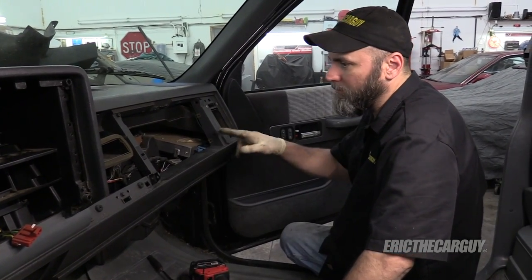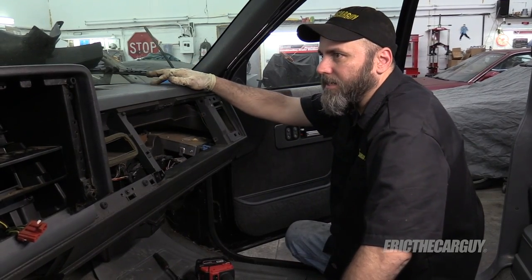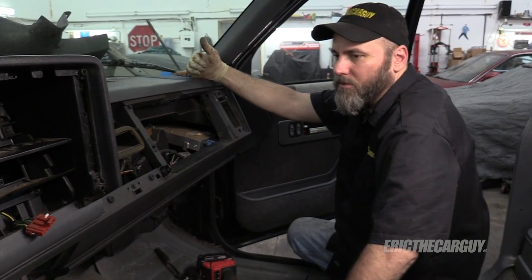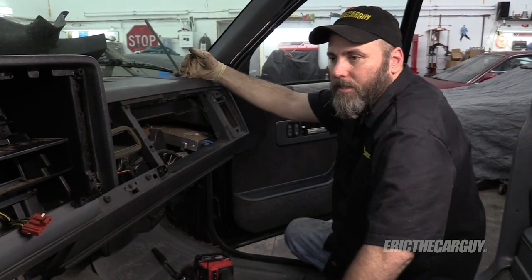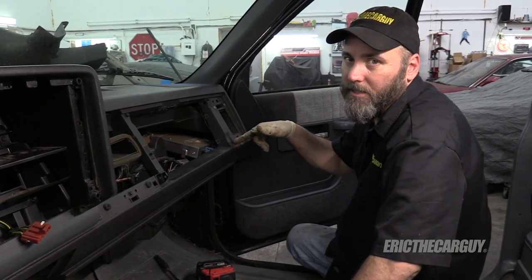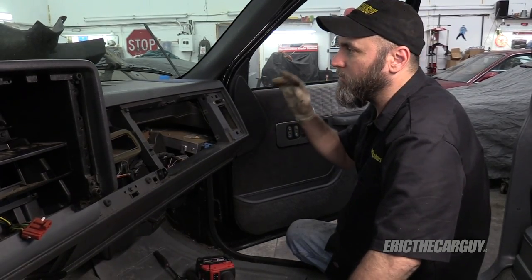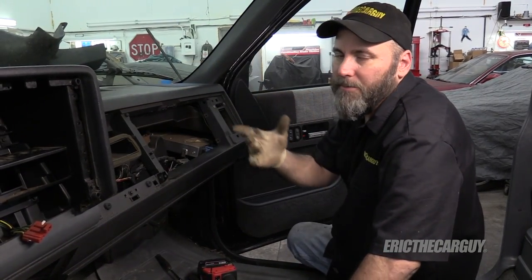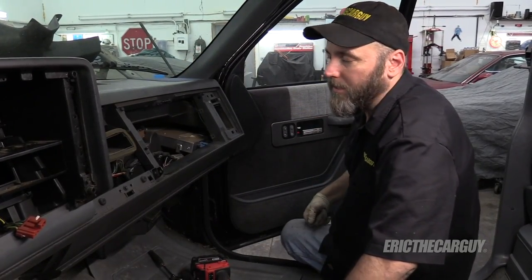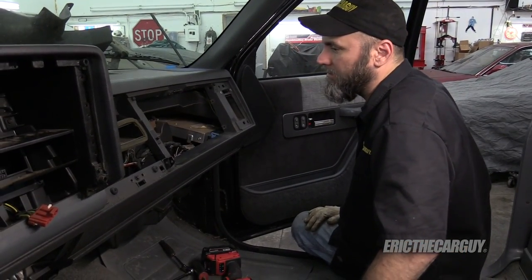Comparing that, I think unplugging the ECU and what I do outside in the engine compartment is just remove the wires that go to the engine and cut those out, and then I can cap off the ends of those wires, even though they'll be unplugged here, they'll be dead. I can cap off the ends of those wires with shrink tube, I've done stuff like this before, and hide them inside the harness. So I'll get new conduit for out there and wrap it all up. You'll never even know. And all you'll see is what I want you to see.